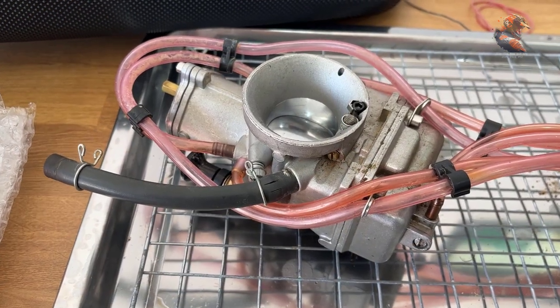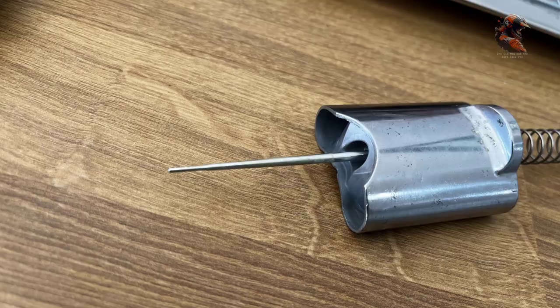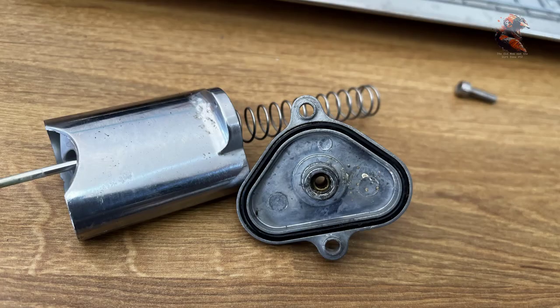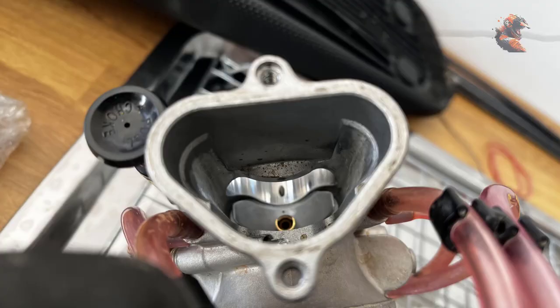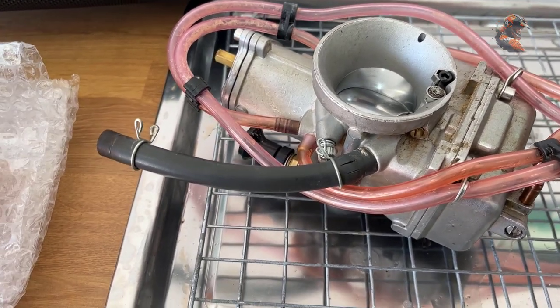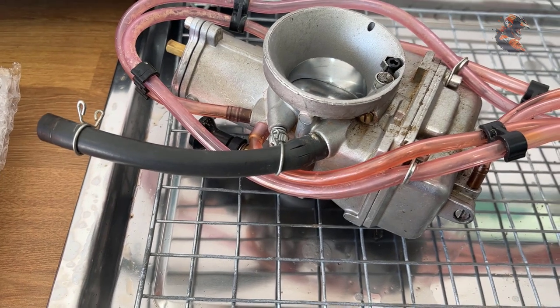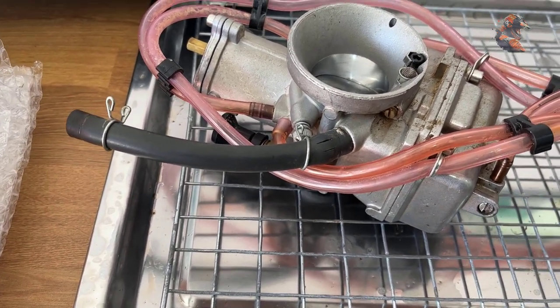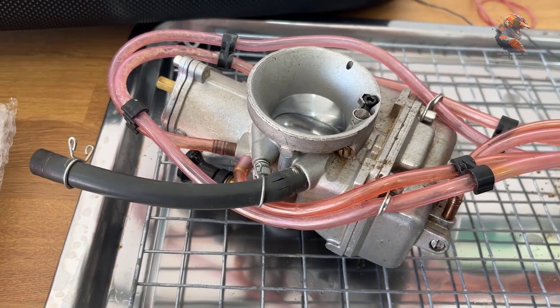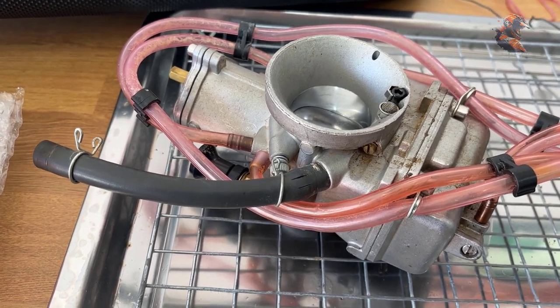The bike wasn't running very smoothly before I started this carb change. Looking at these pictures, you can see there is some strange stuff in the fuel. On the needle there is some layer — I don't know what it is. So it's not that strange that it didn't get enough fuel. We can also see that the fuel line wasn't very good quality — it's cracking. So that's good that I'm changing now. There is something in the fuel here in Thailand I guess, or maybe it's like this all over the world. Let me know in the comments if you know what it is and what I can do to not get this in the carb.